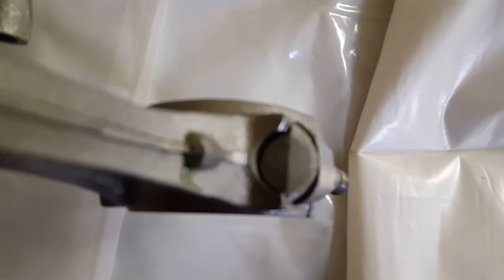When you assemble your piston, the t-slot right there goes opposite the oil squirt hole. The oil squirt hole is right there in that shoulder. Only one of these parts has the oil squirt hole drilled — you can see there's the hole right there in the bearing. So the oil squirt hole is always opposite of the t-slot.